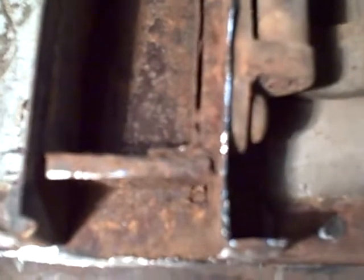Now you'll notice this little seam right along here. That is another place that traps moisture right on that edge, and so this is perhaps why we often see rust right at the union of this A-pillar and the rocker panel. Most of the water would, of course, drain down and sit right on that bottom edge, and I'm not sure that extra little tray doesn't make it even worse. But anyway, a new panel will be welded in there.